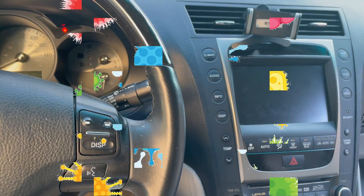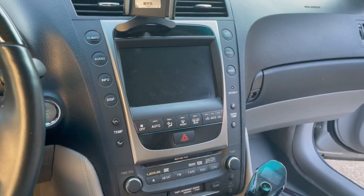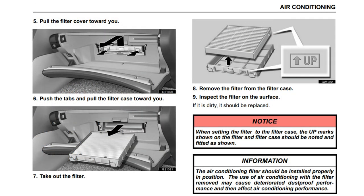What I'm going to do is try to use Lysol disinfectant to kill the potential mold or whatever is growing in there that's causing the smell. To do that I'm going to first remove the cabin air filter. Here are the owner's manual instructions on how to replace it — you're welcome to pause and read, or follow along since I'm also going to cover disinfecting the musty smelling mold and mildew in the AC vent passages.